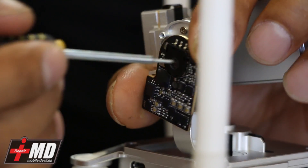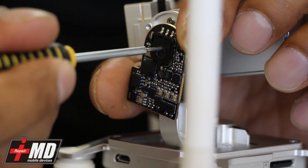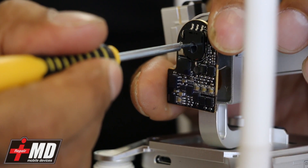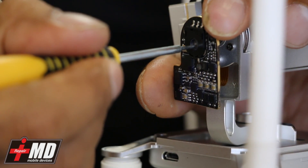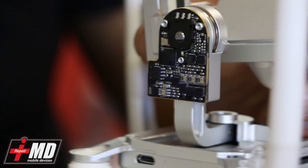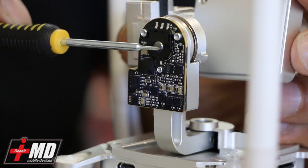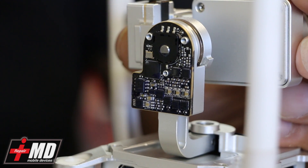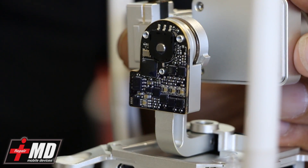If you can see closely, there's actually a flat part of the rod that controls the camera. What we want to do is make sure it is facing down. This piece right here — if you can see, there's a half cutout circle, a flat base right here. So rotate that to even it out, even right there. Now go ahead and actually place that inside. By doing that, you're telling the gimbal that this is the position of rest, of horizon. So we're resetting it.